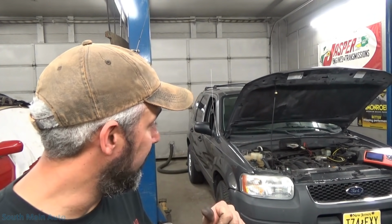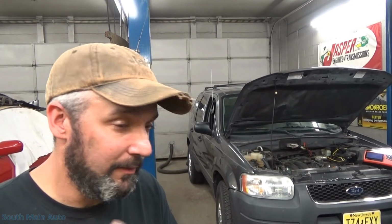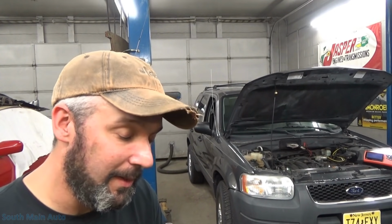And I'm getting ready to walk out the door. And at this point, I'd already gone through the whole data list, like at 3000 RPMs, what changes? Is the purge solenoid kicking on? Is the canister vent opening? Is something changing? Is the duty cycle on the alternator? Something's changing at that point.